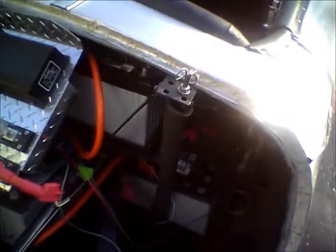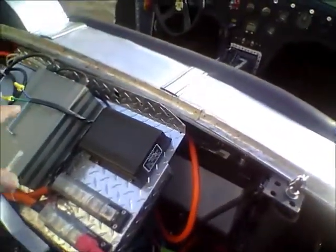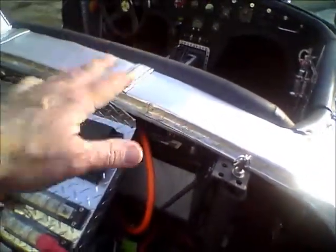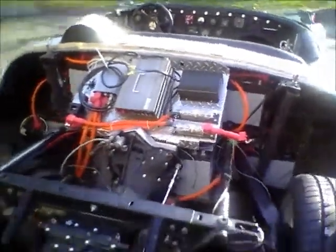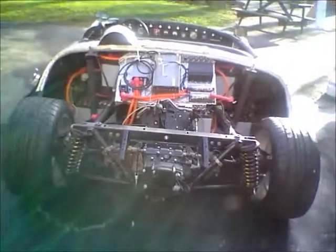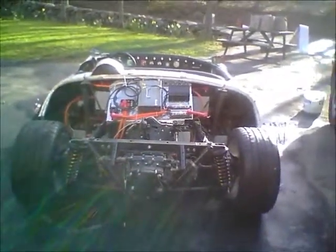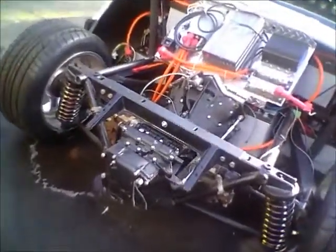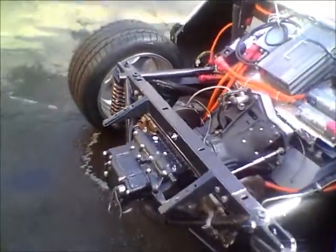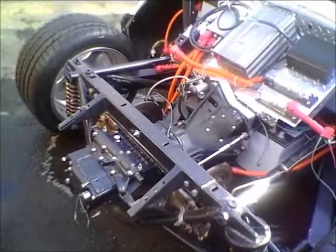I welded up all these battery racks and tried to keep the weight as low as possible. Four batteries sit below the chassis, one is roughly at the center of gravity, and three above are still very low because the car is only 28 inches tall. The roll center is about two feet underground, so going around corners you won't have handling trouble — it'll slide before it ever rolls. That's the Lotus transaxle.